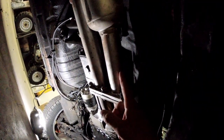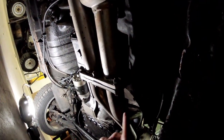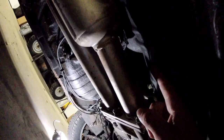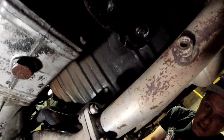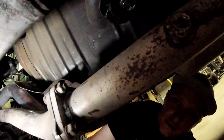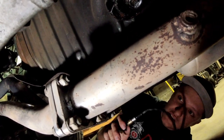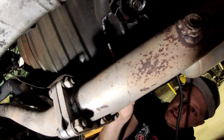Slide under the car. You're going to see right here the header, collector, header flange, and mid pipe with resonators. You can see that it's dual all the way until it goes over the axle back there. The best place that I found to put the O2 sensors is right here. There is a pretty good gap up above this area where my hand is right now, and we have plenty of room to fit the O2 sensor.